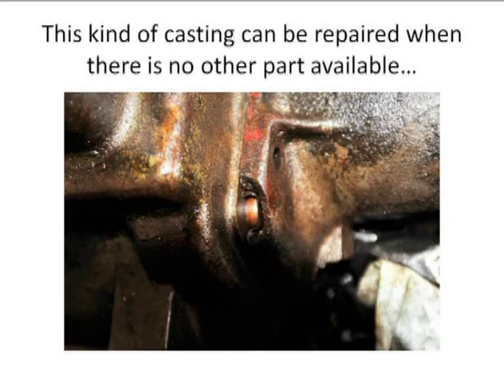Recognize this — have you ever seen a casting like that? The cause of this is probably somebody who installed this tail housing misaligned, and when they tightened the bolts, it broke. I can't imagine any other reason for it to break off of there unless it was a flawed casting. But this casting is glaringly missing a piece — that flange is broken off.